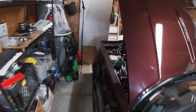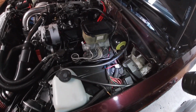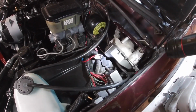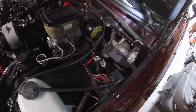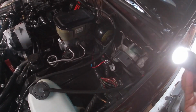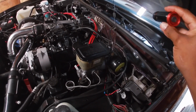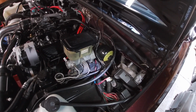I still used that vehicle speed sensor that I bought that was going to plug into the side of the transmission. However, I just installed it here. This is actually hooked up to the end of my mechanical speedometer cable. There's a cable that comes off of that mechanical gear at the side of the transmission, up along under the car, and up to here. Then you have another part of the cable that screws on there, and that's what goes to the back of the analog dash. Well, I took that extension part off the analog dash.